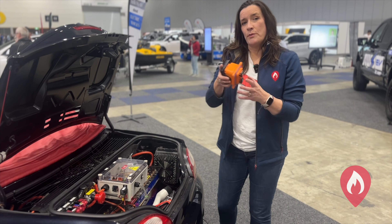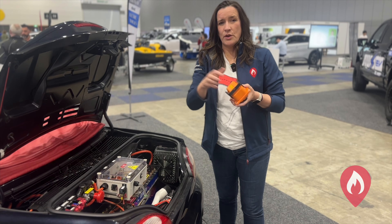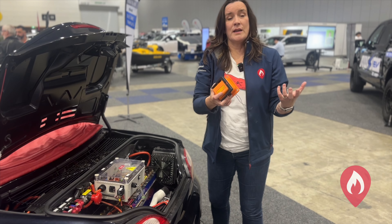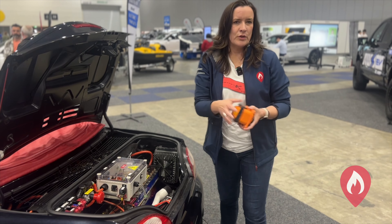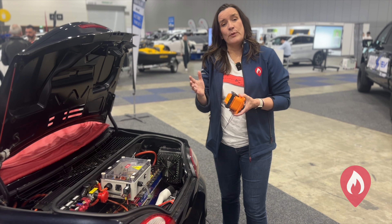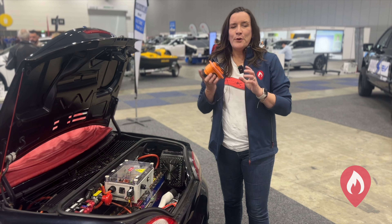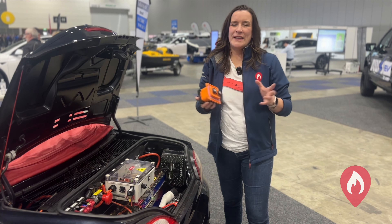As mentioned, a lot of emergency response guides will tell you to find the manual service disconnect, put some thousand volt gloves on, and pull it to isolate the high voltage battery — but this is for a controlled environment like a mechanics workshop, for people trained to do that. It's not something emergency responders should be doing by the side of the road, particularly following a collision or in the rain. So stick with the low voltage ways: the cut loop, the pull fuse, the pull plug. Find your emergency response guide on the ANCAP rescue app, the NCAP rescue app, the EV rescue app, or Moditech crash recovery system. That's been a really quick look, two years down the track from our original video — I hope it's been really helpful. Please hit us up with comments and questions below.